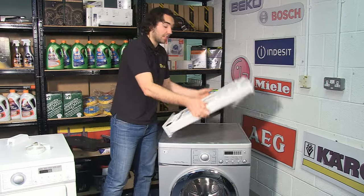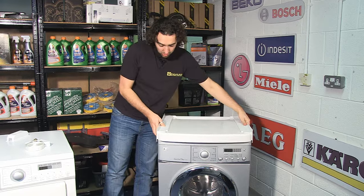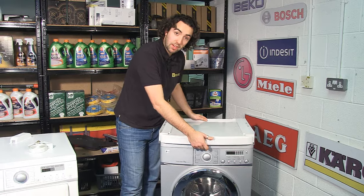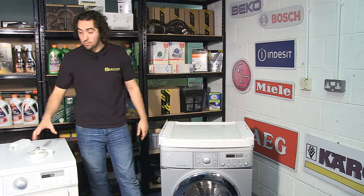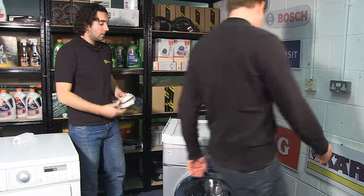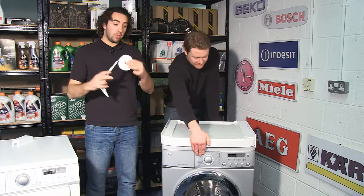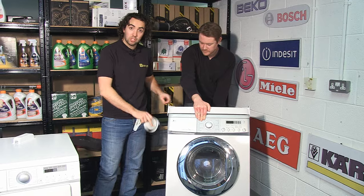The next thing you need to do is sit the housing in place on top of the machine, and just make sure that the front of it is slightly overhanging so that you're able to pull the shelf out, like so. For the next part of the process, I'm going to need a second pair of hands, pulling the washing machine back while I feed the belt through the holes in the side of the housing down and around the machine.